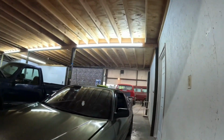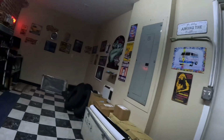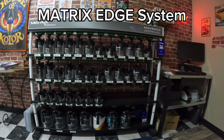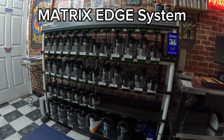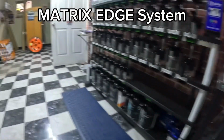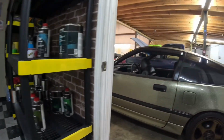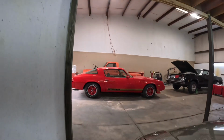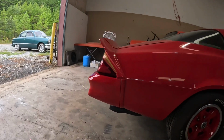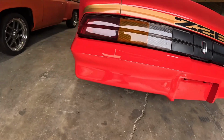I'll show you guys how we get a match like that. Follow me into the paint room. So this is our paint room. It's our mixing system, a Matrix Edge mixing system. You can make any color you want, including House of Color. We have this camera here. What you do with that is you just go out and buff a place on the car, put that camera up there. It takes 3 different pictures, you plug it into your computer, and it generates its own paint code if it can't find one that's an exact match. You can see how good that one matches. That is a computer-generated paint code.